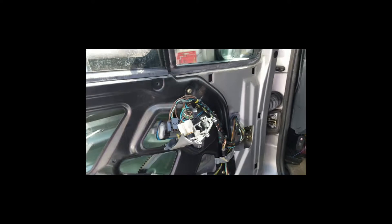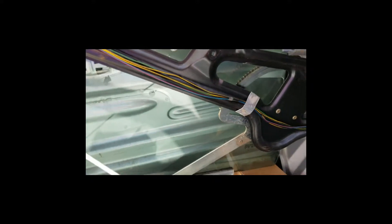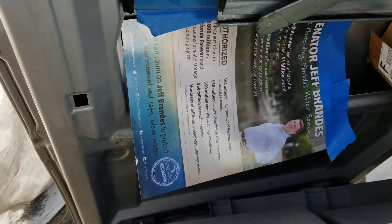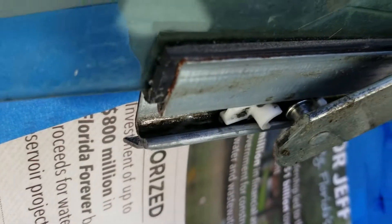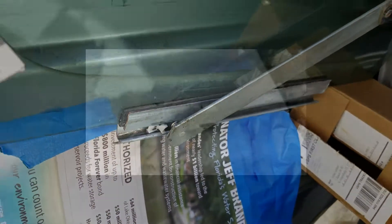On the Mercedes Sprinter, I attached the control unit, pre-marked ahead of time so I know which arm goes to which window. I brought the regulator up to the groove and cleaned the entire sliding groove well before putting the original plastic piece back in to mend it and tie it down with a tie strap, preventing it from falling down inside the door. I put the plastic sliding piece back in to see how it fits before gluing it, making sure there's no grease whatsoever before using JB weld.